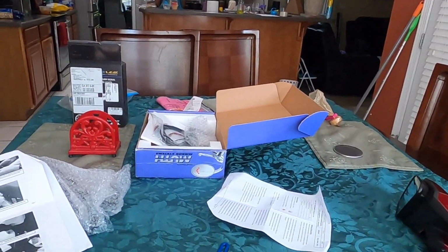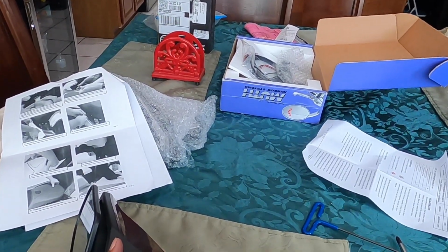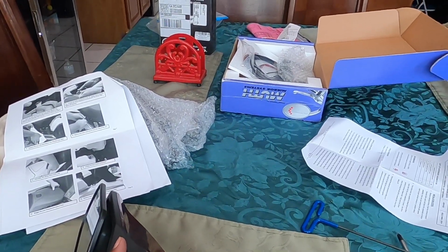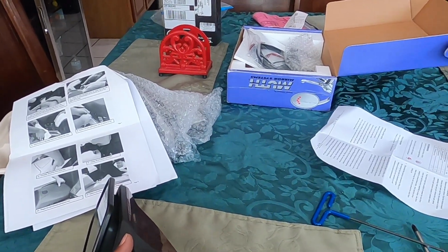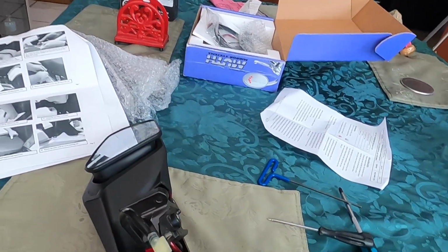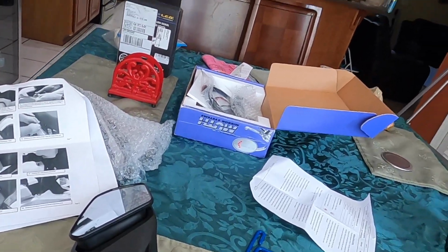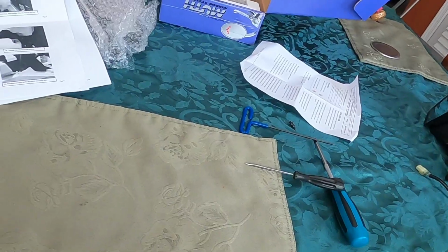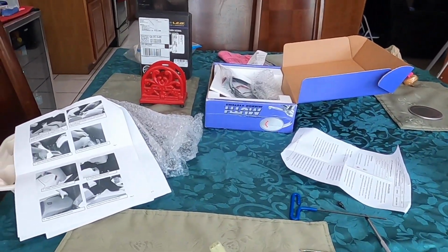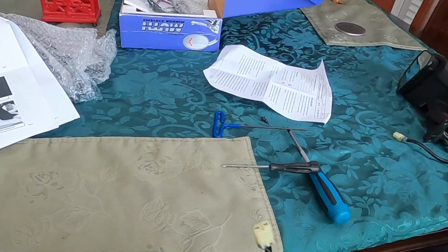There, you can fold that back out of the way. Now you have access to this mirror housing, this clip. Carefully insert a screwdriver underneath and pull that out. Go ahead and reset the clip. If you take it back in, just push it back through like that. You have to remove this clip here, so you can pull your wiring back through this. So when you pull it off, it won't be a problem.